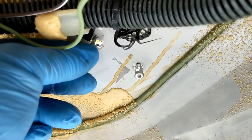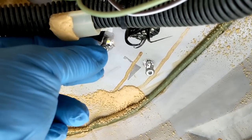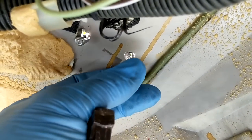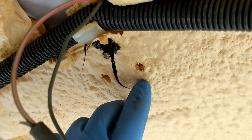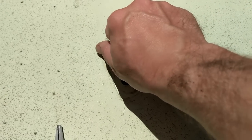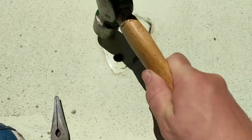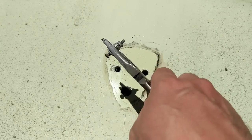On the inside you can see those rivnut-type fasteners for the running lights on top of the roof — they're just these tri-wing bent things. I take a pair of pliers and squeeze the wings back in to pop them out. Where I have to dig through foam it's even easier — just thread them in from the outside, give it a couple of whacks with the hammer, and it pulls right out.